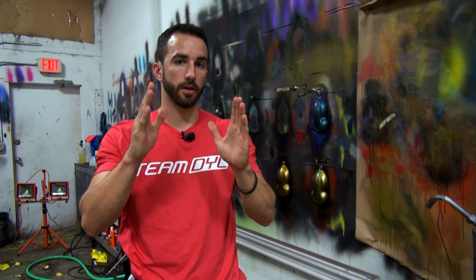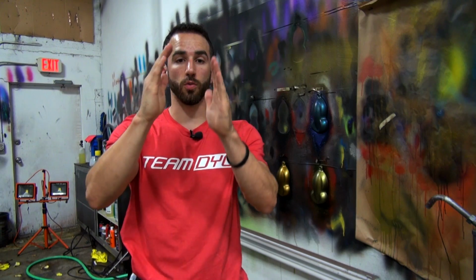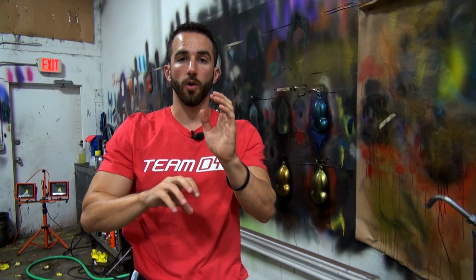Okay, now let's talk about a little bit of troubleshooting, some issues that you may run into when using the product. The first thing we're going to talk about, obviously, is texture. There are a lot of variables that can come in if your product doesn't look like our cars or our results here with that smooth, flat end result. If you end up with texture, you have to take a look at what you're doing. What gun are you using? Is that gun spraying a perfectly even spray pattern? Or is it top heavy or bottom heavy? Is the gun spitting? You want a perfect football shaped paint pattern. You don't want any spitting up or down on it.